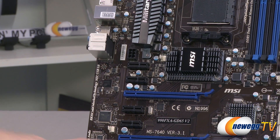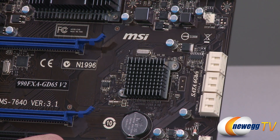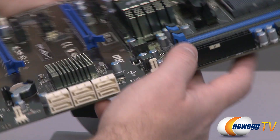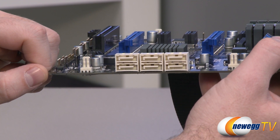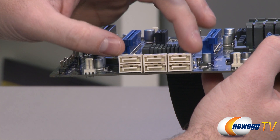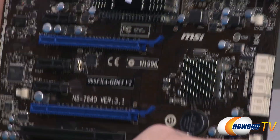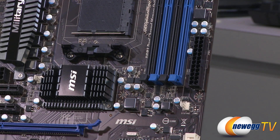On the right side is an aluminum gray heatsink over the SB950 Southbridge chipset, which controls several components and I/O in that area. There are six SATA connectors, all the same color since they're all the same speed — SATA revision 3, 6 gigabit per second — all controlled by the SB950. This is especially useful if you plan to use multiple SSDs or faster drives.